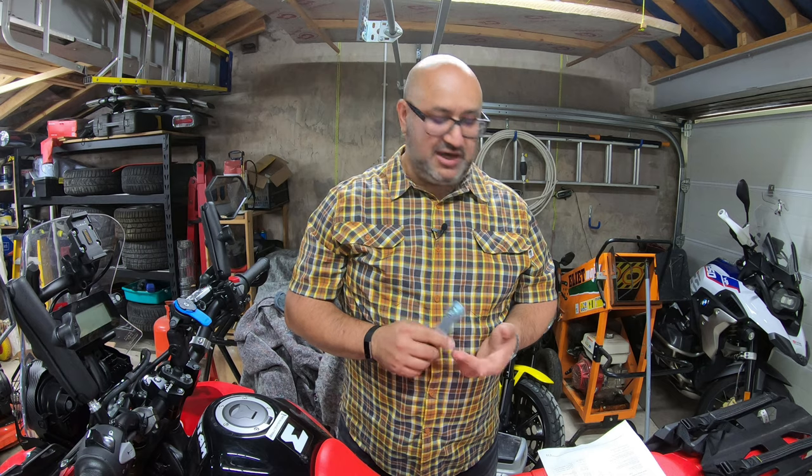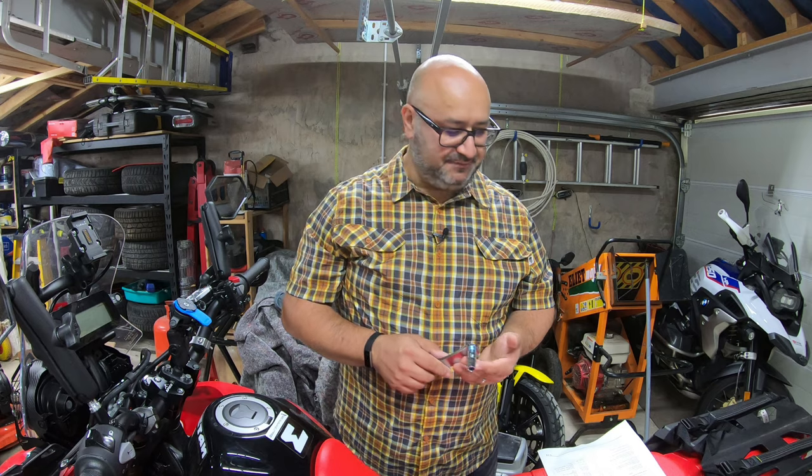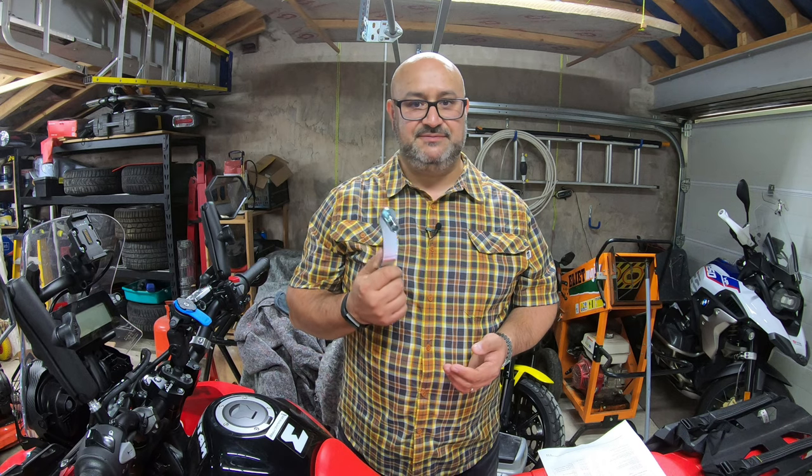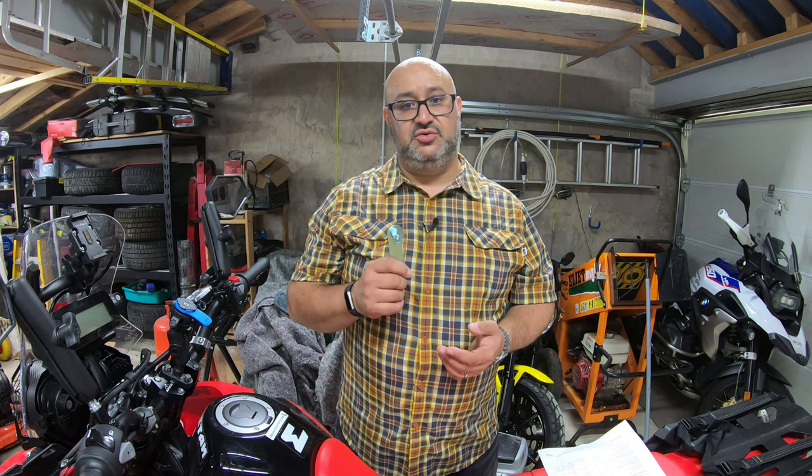First, the front axle. I don't have a service manual for the 300 but I have one for the 250 and I believe it's the same. The recommended torque for the front axle is 73.5Nm, which is 54 foot-pounds — that's a lot. Anyone who's taken their front wheel off will know you need a pretty long wrench to get it off and a big torque wrench to do it back up. If your front axle is set to the recommended torque, I don't think you'll get it off trailside using this. Rally Raid have acknowledged this — they recommend you loosen the pinch bolts before you go out, loosen the axle using whichever wrench you need at home, then tighten it back up using this and tighten the pinch bolts again. It won't be as tight as factory spec, but the pinch bolts hold the axle so it won't come loose. The alternative is carrying some pretty big tools. I know people have used Motion Pro wrenches and ended up standing on them to get the axle on and off.